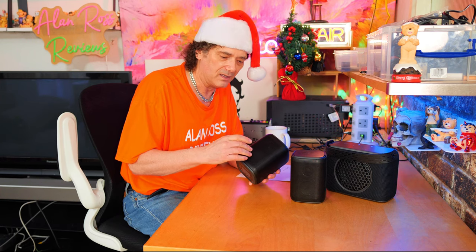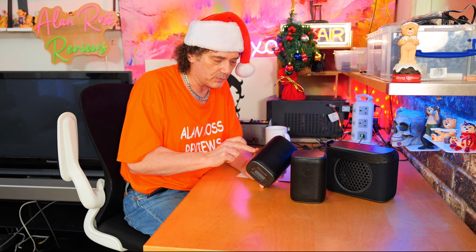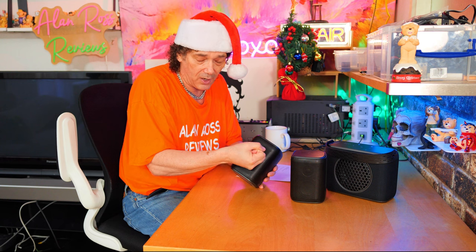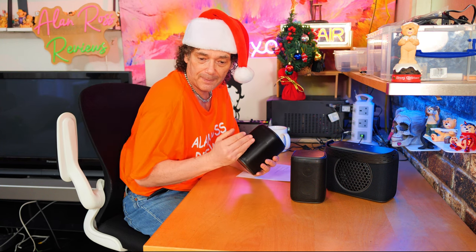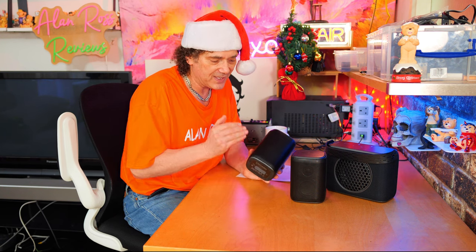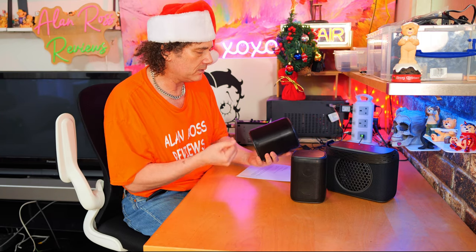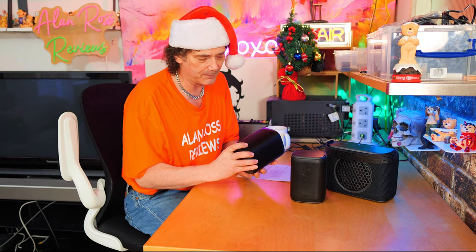Normally, at a minimum, you'd get almost an identical passive radiator to the woofer, just without the voice coil. It's going to be driven by the excursion of the woofer going in, the air pressure increasing, and then pushing out on the passive radiator. Of course, the passive radiator does not play deeper than the woofer. It plays exactly the same frequencies as the woofer, but just those frequencies that it's tuned to, but the woofer has to still be playing them. So it fills them out, it makes it fuller, but it's not playing deeper than the woofer itself, it's just making it louder and that you can hear it more, because it's reinforcing those frequencies, and that's the point.